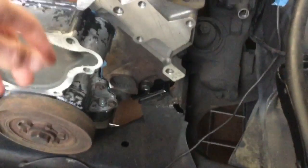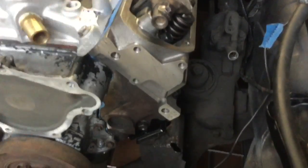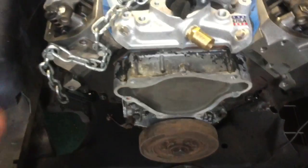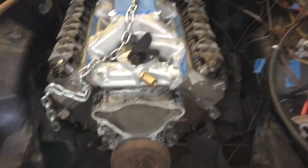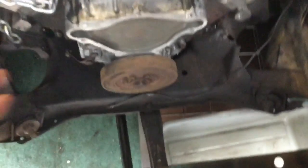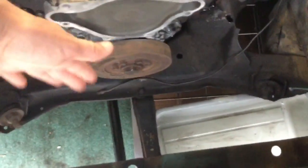I'm just at a loss for words. I was going to come out here and put the water pump on, put the alternator on, put the starter on, everything else I was going to do. But I didn't want to put it all on and then have to just take it right back off, because it was a tight fit getting it in as is. And I don't want to put stuff like the water pump on — the water pump has a gasket, for example — and if that was on, we wouldn't have got the engine in. So that's why I haven't put it on.